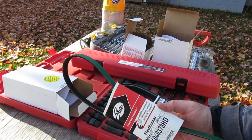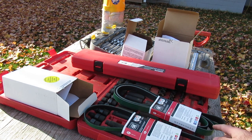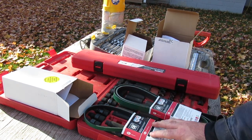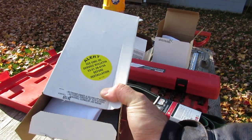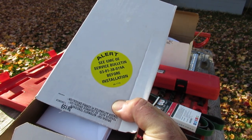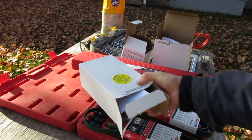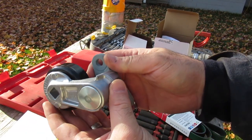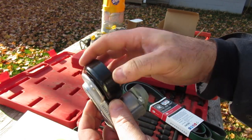There are two belts on this vehicle. The air conditioner belt is tucked in behind the main serpentine belt, so to get to that one you more or less have to take care of the main belt first. For the air conditioner you'll need a tensioner. There's actually a problem with the way they originally mounted these AC units — there's a service bulletin about it. If you're getting banging sounds from under the engine under acceleration, look up that bulletin. What happens is oil gets into the AC compressor and causes it to swing back and forth, damaging itself.